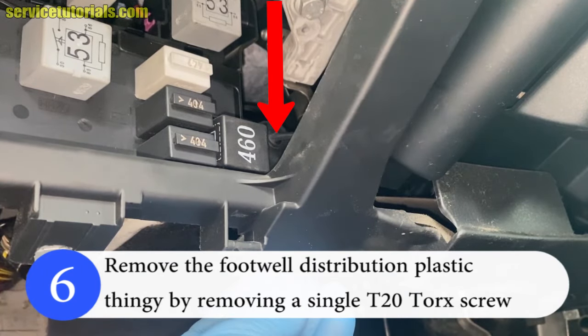When you have to attach the clamps, make sure that both edges of the pipes are covered by the clamp. You will know that when it's easy to bring the ends of the clamp closer using your fingers to put the screw back. Attention! The clamps must be mounted in the same position as the old ones. Otherwise, when fixing the plastic cover back onto the heater, it will no longer be fixed correctly.